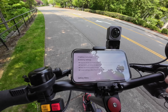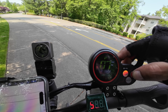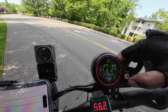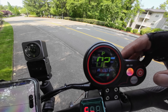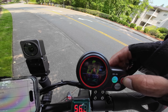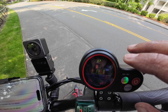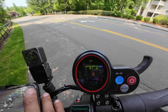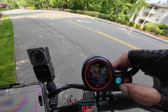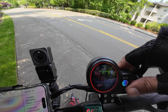Now we're on P1 — LCD brightness. P2 is speedometer units; the scooter ships with speed in kilometers, so change it to miles per hour here. P3 is battery voltage — leave on 52 volts. P4 is auto time-off. P5 is unused. P6 is wheel diameter — don't adjust. P7 is motor magnets — don't adjust. P8 is power level — 100 is max. P9 is start mode: change it from throttle start to kick start to eliminate whiskey throttling.